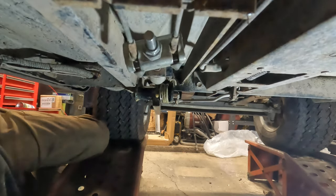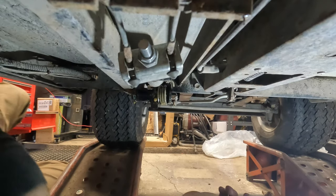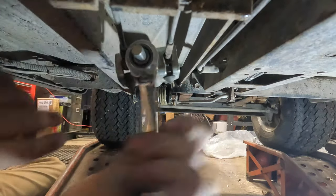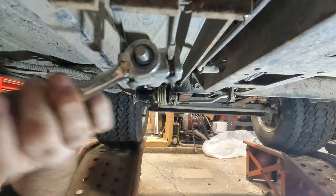All right. Brake pedal doesn't lock either because it's not set correctly. Like I said, we got to keep these loose. That's one thing a lot of people forget to do, is loosen these up when they're adjusting their brakes. Or they'll just tighten this up when they're adjusting their brakes, thinking that this is the right adjustment. But I like to back this out.